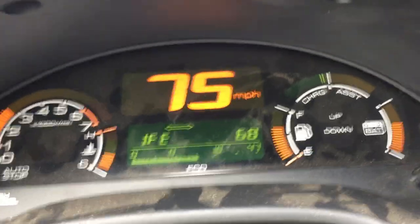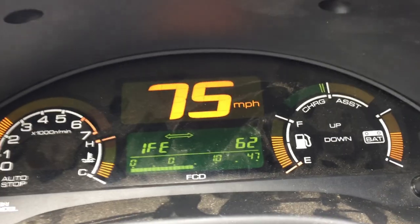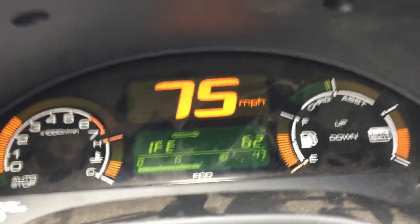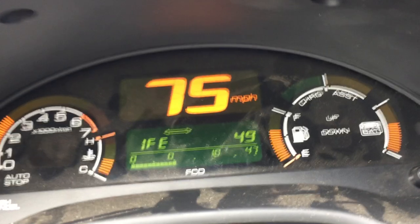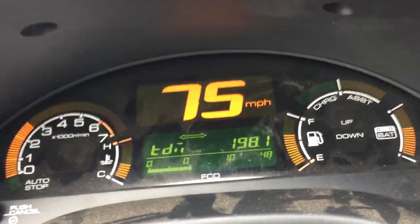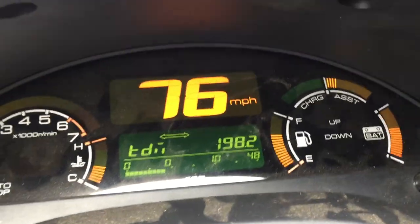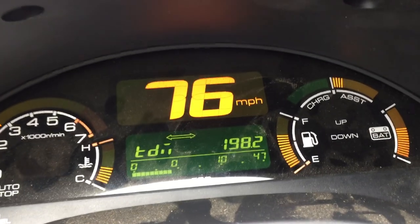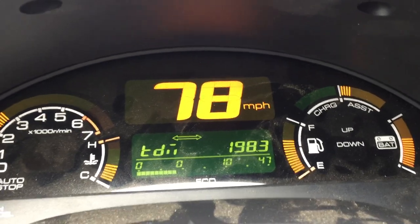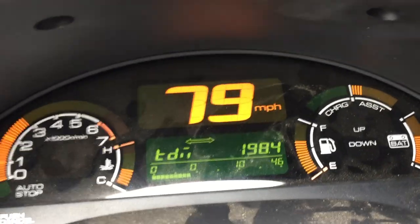Instantaneous fuel economy, which is really cool. I think there's a little bug right now where it reads like 6% low or something. I'm not completely sure. However, as far as instantaneous goes, I find that it's much easier to look down and see the IFE instead of having to interpret the gauge. So I can just look down and say, hey, look, I'm getting horrible mileage, which is most of the time. This TDM feature here introduces a couple concepts. One, the display here can't display all the characters, and Mario's mentioned this. That character after the TD is an M. It makes sense once you get used to it. I think K is the weirdest letter, of course. It's really hard to display K.